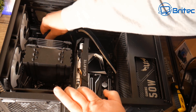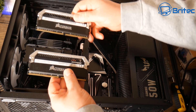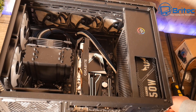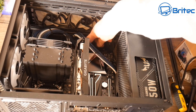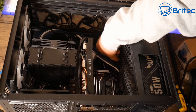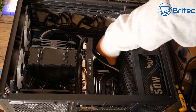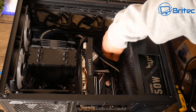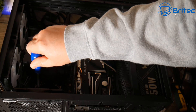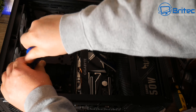I'm going to go around and pull out all of the cables and disconnect everything on the motherboard, and remove the RAM. I've got 32GB of Corsair Dominator RAM here, so I'll put that to one side. The PC is not that old — it's got an i5-10400F and a 1660 Super in here. I'm going to remove all of these bits. The motherboard is pretty good, so the CPU could be upgraded to an 11th gen processor. I'll remove the CPU cooler first, then the graphics card, and I'm also going to replace all of the fans.